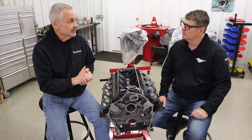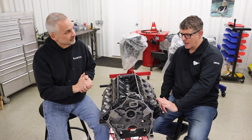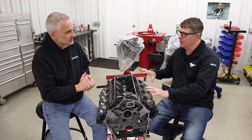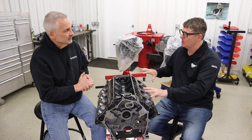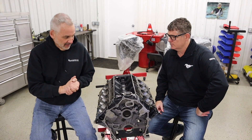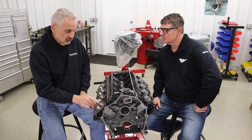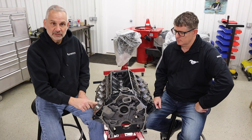The previous engine we were running stock head gaskets. You just have a flat decked surface, and all of your sealing is done by the compression of the head studs or head bolts. So that's the new feature. Also on this, it does have the receiver grooves machined in it.